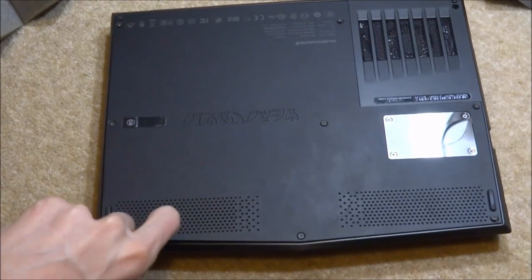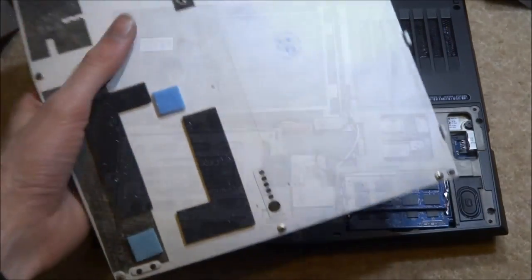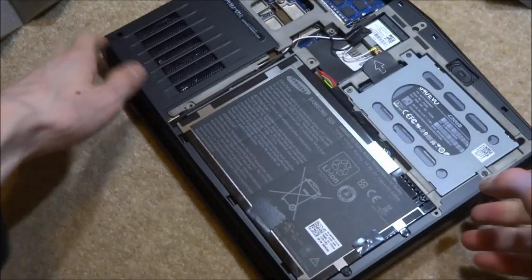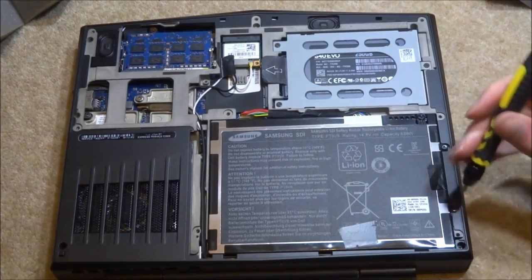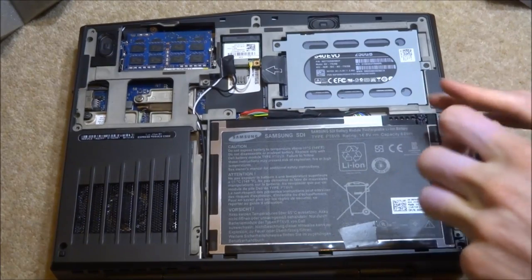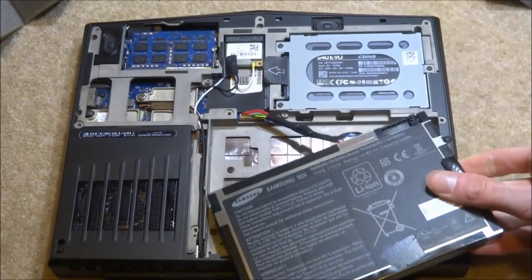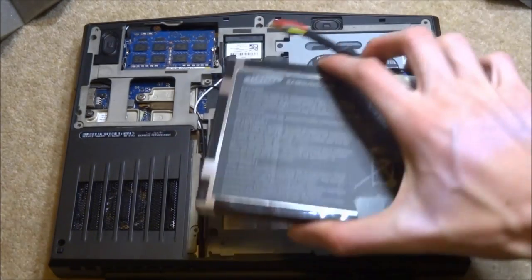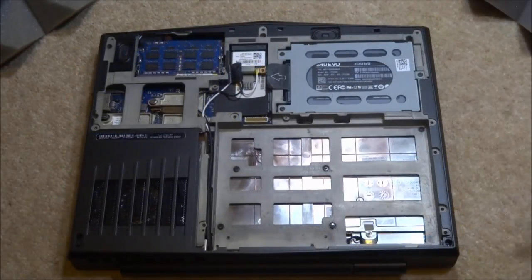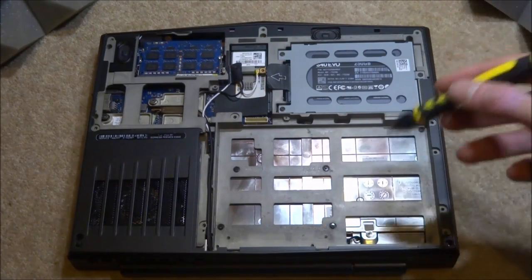I'm going to speed this up so the video isn't boring. There you go — all the screws are out. We've got three screws along the bottom, three going across, and two at the top. Once all screws are out, you should be able to hook your nail under the plastic clips and just pull the bottom panel off. There's the bottom of the laptop completely removed — put that to the side. Next we need to take out the battery. It sits here with screws surrounding it — just two Phillips screws. Use the plastic tab on the side to lift the battery and move it. Don't yank the cable. Put the battery to the side carefully, then take out one screw here and one screw here — these will come out completely, so keep them in a tin or small box.